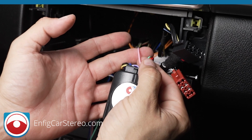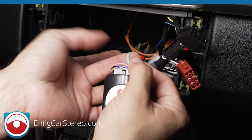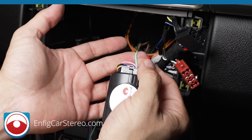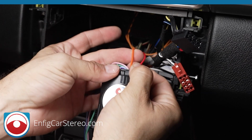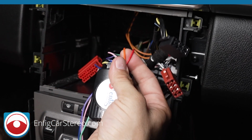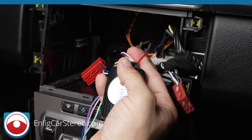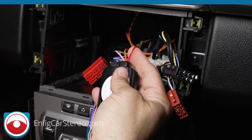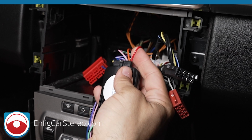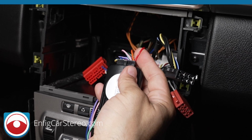Most of the radios that use this are high-end Pioneer and Kenwood. You don't see too many radios that have that. Parking brake, it shows ground when the parking brake is up to unlock security features. A lot of you guys are going to do illegal bypass. Illumination, important wire. It dims the radio at night when the lights are on, so that way you don't have a bright radio in your dash, lighting up like a Christmas tree the inside of your car. And then the red wire is the switch 12 volts wire. That tells the radio to turn on and off with the key.